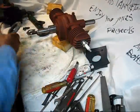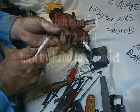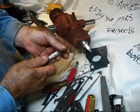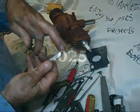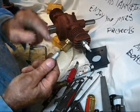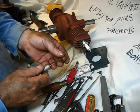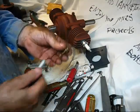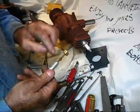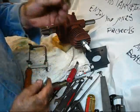You will need some kind of tool like this. Another tool I use is on this little carburetor — that orifice in there is a number 72 drill bit size. A number 72 drill bit is only 25 thousandths of an inch. That's a really tight fit. You do not want that hole any bigger than what it is. Do not use a torch tip cleaner as a reamer in those orifices — it needs to be a good, round hole. If someone has drilled it out larger, you can swage it back together, re-drill it, and save it.